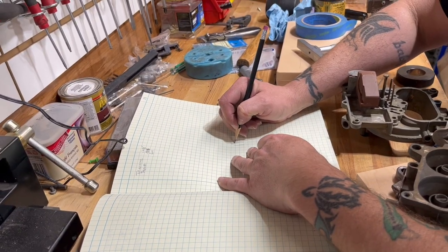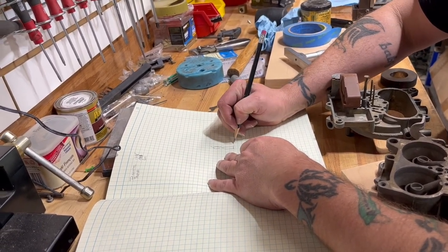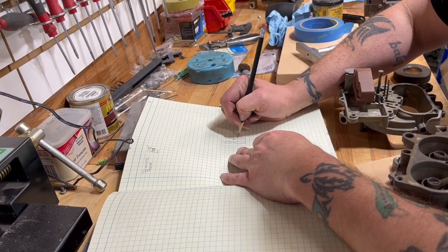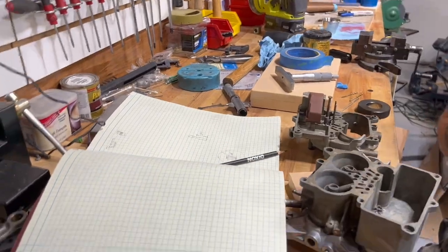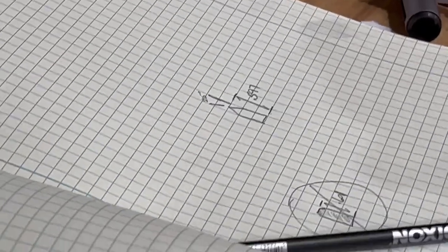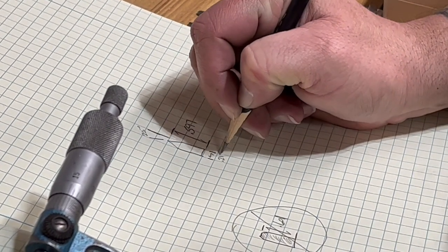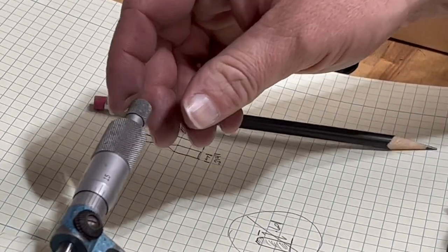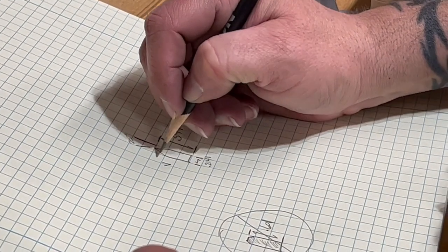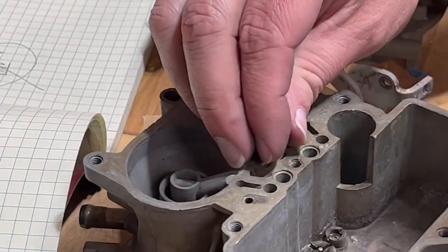Too tight. And you had, what was it, a 25 degree taper? Yeah, so 25 degree. And then from here to here, we're at 0.597. And our diameter actually wound up being 0.2141. So there is version 2, and bam.